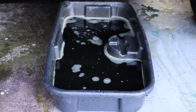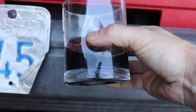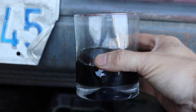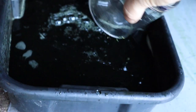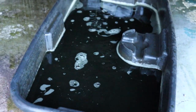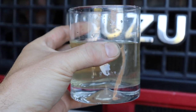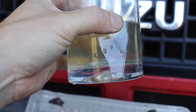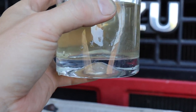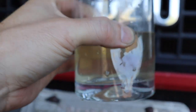Here's our first flush of just water and it is pretty gnarly looking, guys. We're going to be doing this for quite a while. Pretty gnarly still — really nasty, and this is just water. Time to do another water flush. This is the fourth full water flush after using the ThermoCure — it took a long time to get here. I did about two heat cycles for each one after the first, so the water stayed in longer and cleaned up a little better. That's pretty damn clean water to be coming out of a cooling system this old, so we're going to go with it.